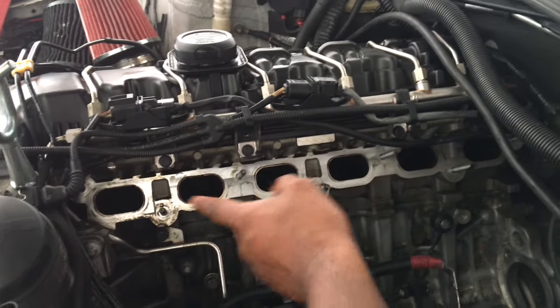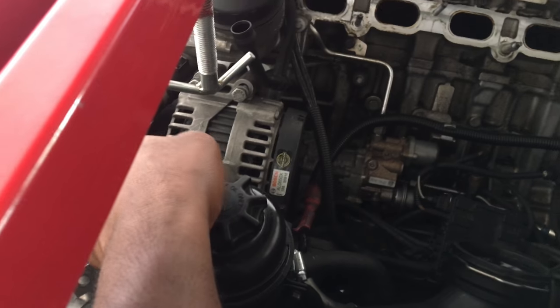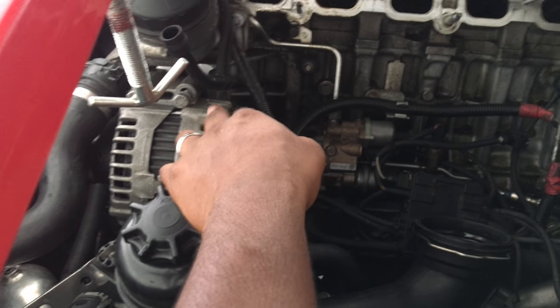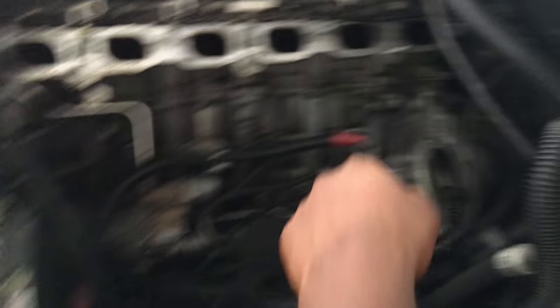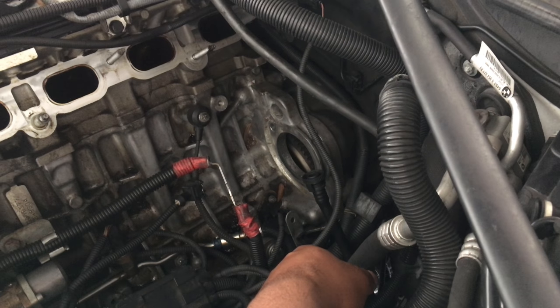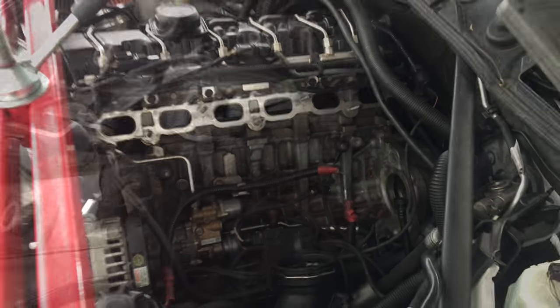The main thing is I went ahead and disconnected the intake manifold and moved the power steering reservoir out of the way. In my case, because I have the inlets rerouted, they kind of were in the way, so I had to move those over. And then I took the starter out. That's the only thing you have to do on top of the engine to drop the transmission.